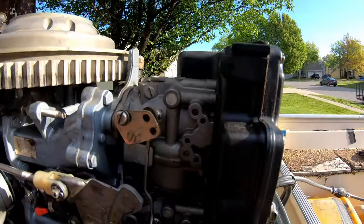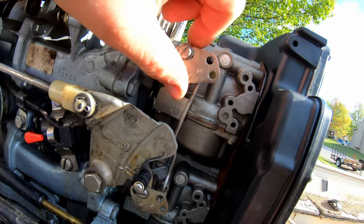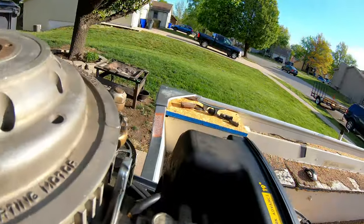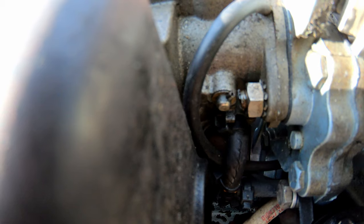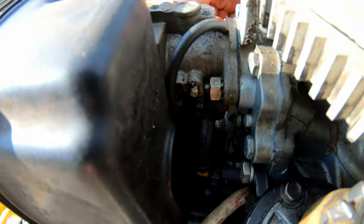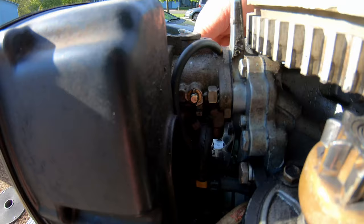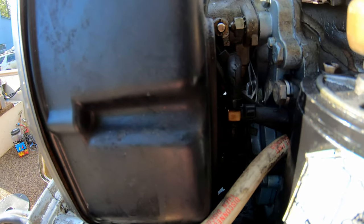What we did was repair that hose. For the little flap for your choke, you want those to be lined up — you don't want one all the way open and one closed a little bit. The way you can tell whether your butterfly choke flaps are opening at the same exact time and amount is you come over to the other side. When I spin this and get it vertical — straight up and down — I look down at the other one. When this one was completely vertical, the one below was just a little bit off.